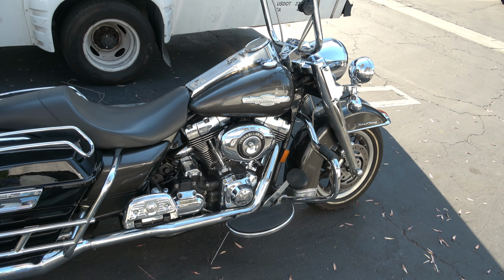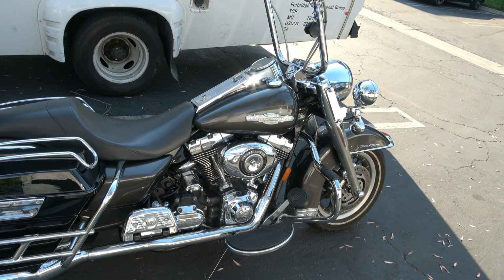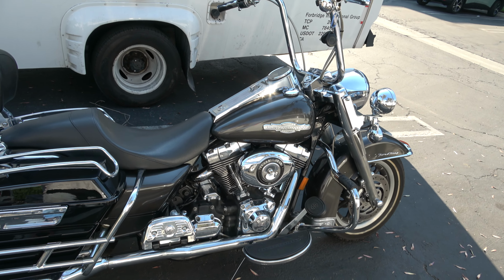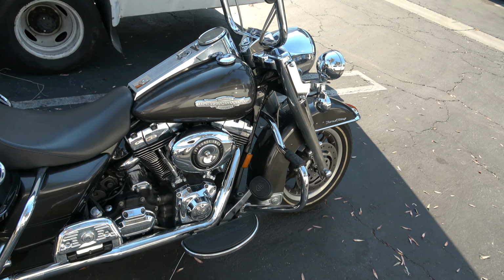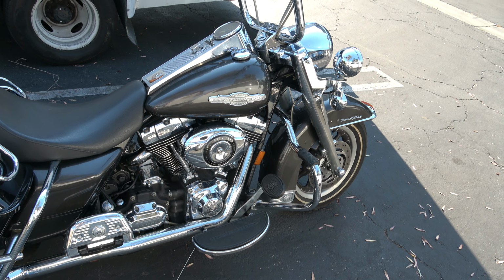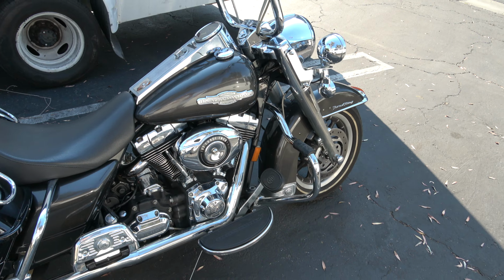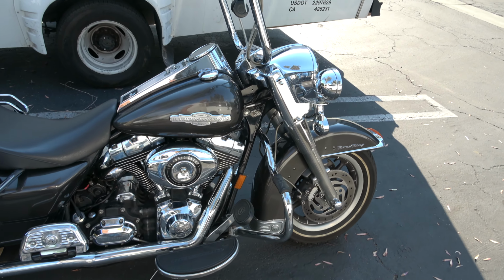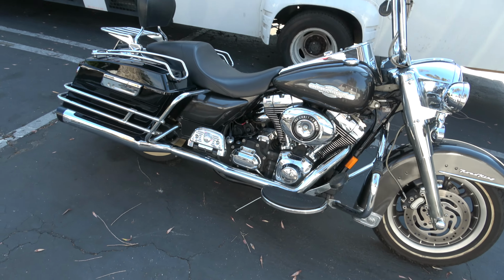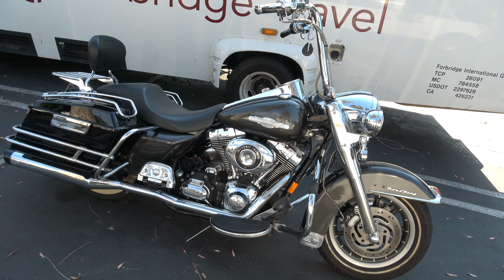Oh, what about an M8? Well, I haven't owned one, but from everything I've been seeing on YouTube, they're grenades. Unless you replace the entire timing chain area, the cam backing plate, the cam, put a gear drive in it, put an oil pump, put a breather in it, then you got a beautiful motor. It's only $5,000 to do that. Wow. Only.